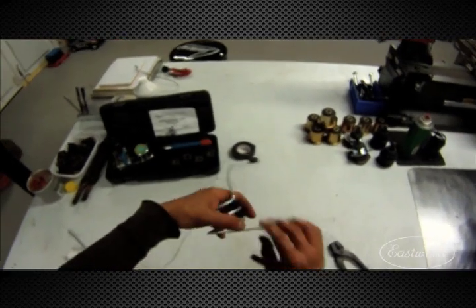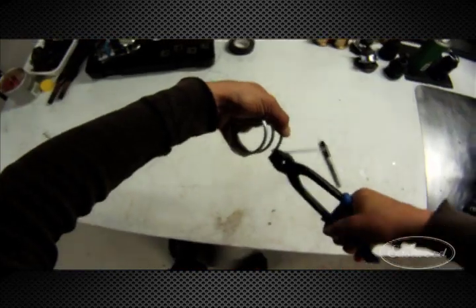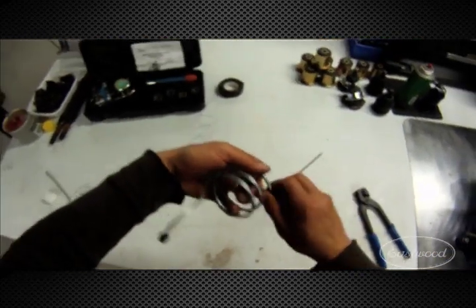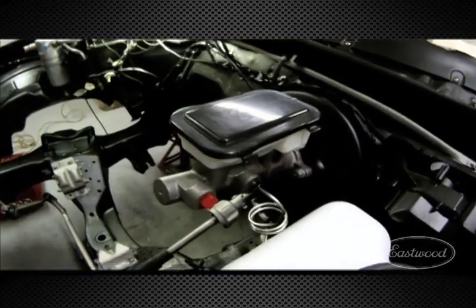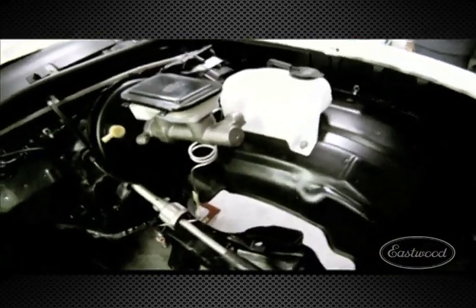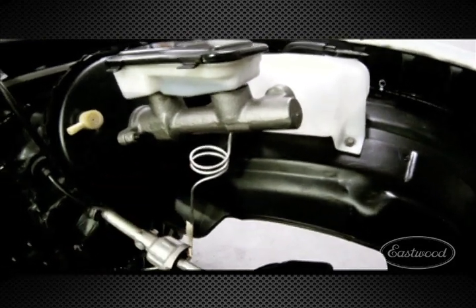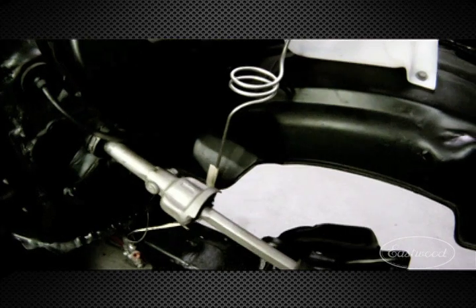The last thing you want is any kind of stress marks on a brake line. Let's go see how it fits. Here's the completed line — first line rough installed. As you can see, we mocked it up — better strain relief with our coil here, just as we want it, just like OE. Come on down.